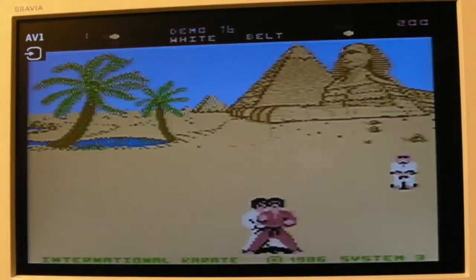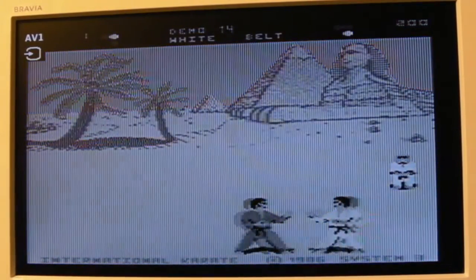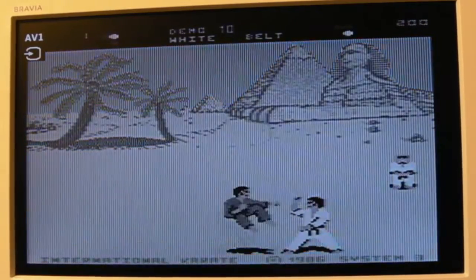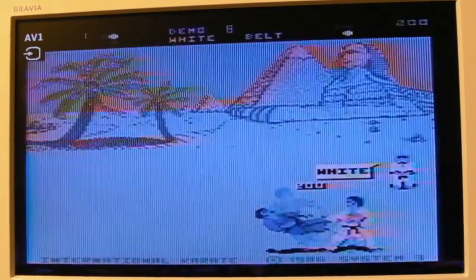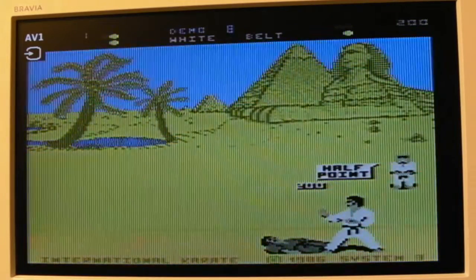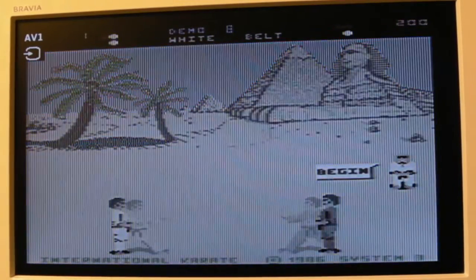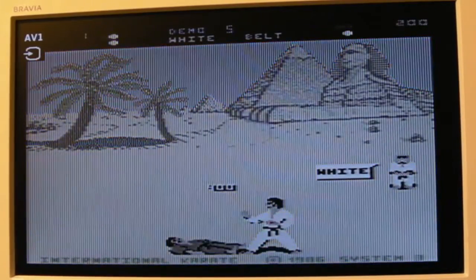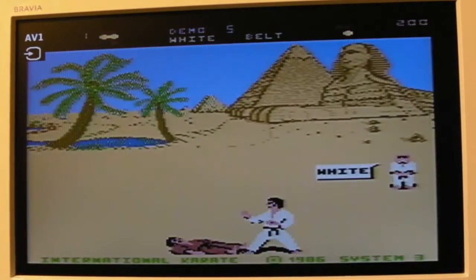I just need to see now whether, hang on, I'm not sure, maybe it's doing this colour thing again. Maybe the trim pot there, the trim resistor, is not set exactly correct, it might be marginal. Well, super annoying. About an hour later, you can see we've got that issue. I honestly do not know what is going on with this. I need to measure around that circuit again, make sure that diode's still alright. But we changed the transistor. Maybe one of the caps around there is a bit balked or something. That might ultimately be what killed the diode.